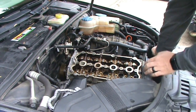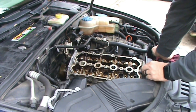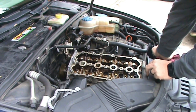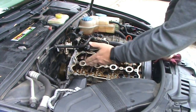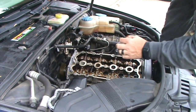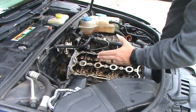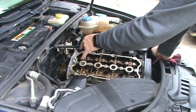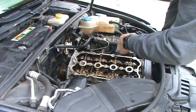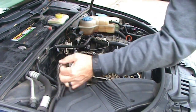So at the point I'm at now, I need to get this timing belt cover off so I can see the timing belt, make sure I get my exhaust cam in the exact top dead center position that it needs to be, and then from there I'm going to crack this loose, get the intake cam off, put the new chain on,